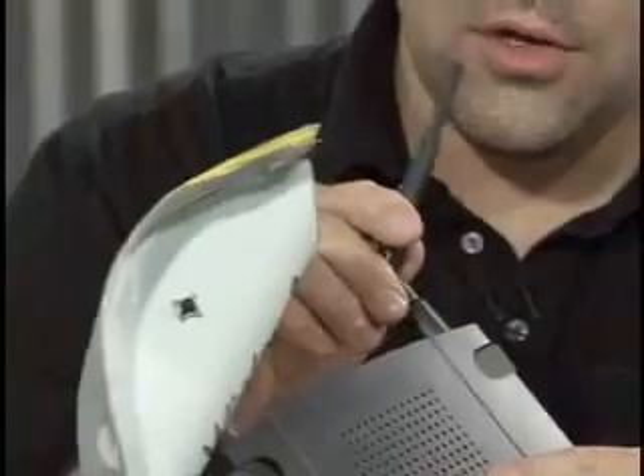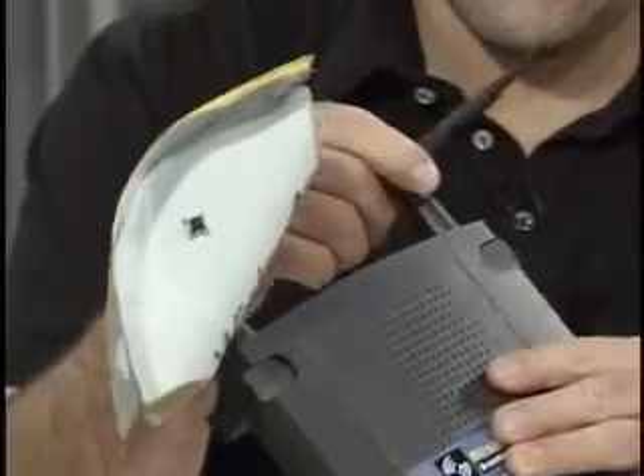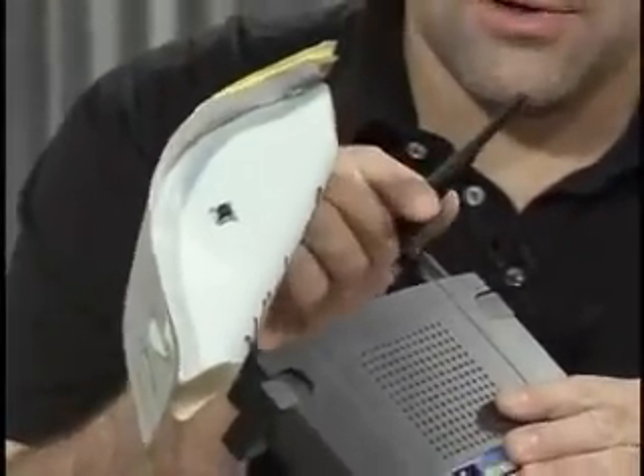You could go out and spend like $50 for an antenna to bolt onto the back of your router — or $20 to $50. A 7 dB antenna is usually going to cost you about that. And you have to make sure you actually have removable antennas on your router. If they're not removable, unless you really enjoy cutting things open, hacking, and violating warranties, you're not going to put up the super antenna on your router.